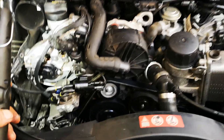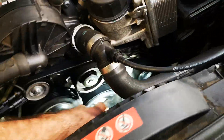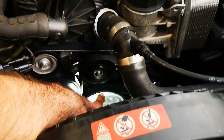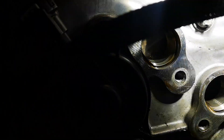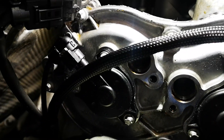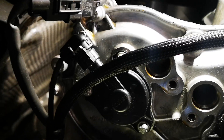So get ready if that's going to be the issue. You get a 27 mil socket on here — there are numbers there. There's a silver line on the block right behind this pulley. You mark 305 degrees, you pull these two sensors out. The exhaust, which is the P0017 exhaust retard code, is not in the middle.